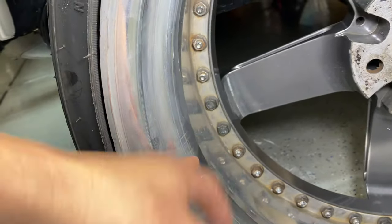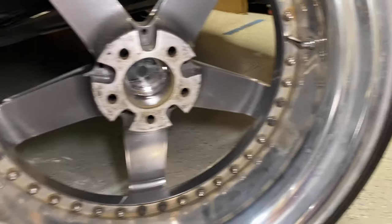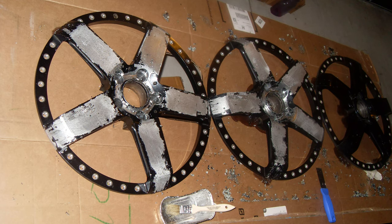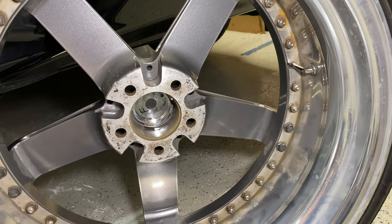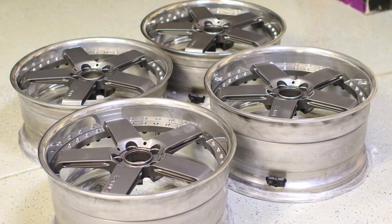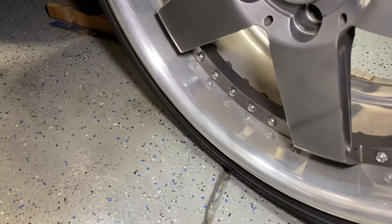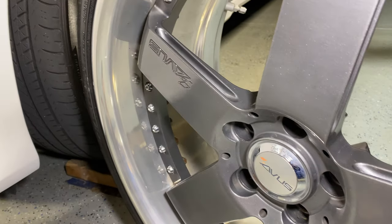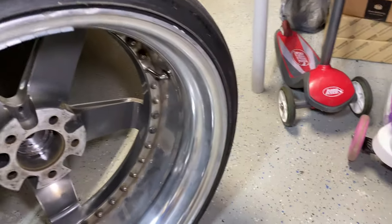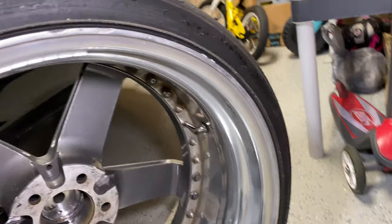I got a drill bit big enough for the hole, drilled it, and it's worked ever since — no problems. I've got the TPMS valve back here and my main air valve angled up. On these three-piece wheels I've rebuilt them twice. The first time I just refinished the faces without separating the barrel. The second time I actually pulled everything out, sent the chrome lips off to get stripped so I could polish them. Now I've got polished lips, which need to be maintained, but I'll take maintaining polished lips over corroded chrome any day.